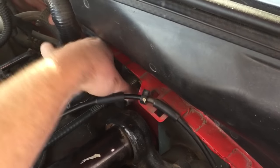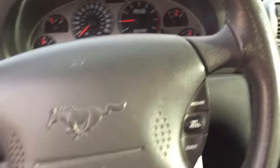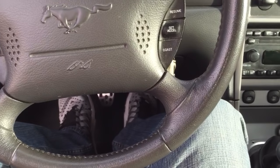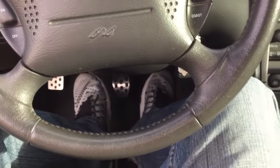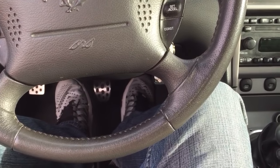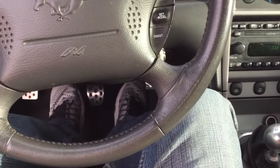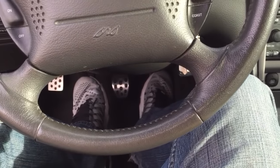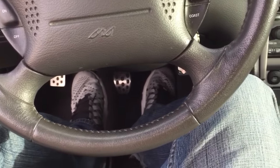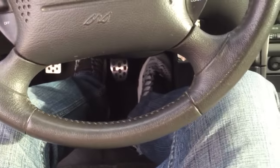What you'll notice is you'll have a lot more slop in the pedal. Without the free play elimination mod, your pedal will shake and dance around because it's basically loose under there. People adjust it this way with the theory that if the throwout bearing isn't spinning all the time it'll last longer. However, going from zero to engine RPM every single time you push the clutch could actually wear the throwout bearing out faster. The other disadvantage is less travel, which means you can get locked out of gears while racing.